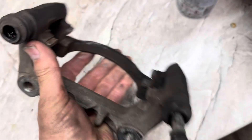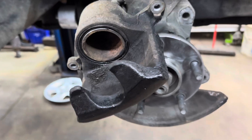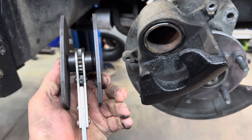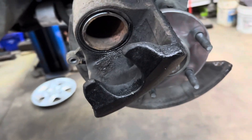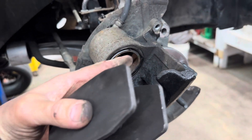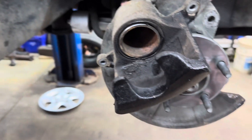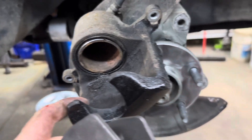Put some paint on the brackets and let them sit. Next, push your piston back into your caliper. If you've got the ratchet style, ratchet it back in. You can also use a big pair of channel locks or a C-clamp with an old pad to push the piston in. This one should have the calipers replaced but the customer doesn't want them, so clean them up as best you can.